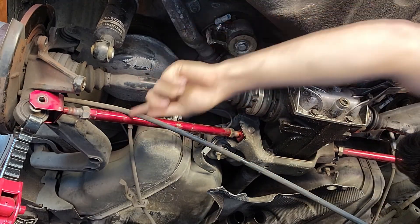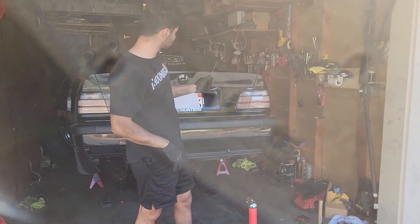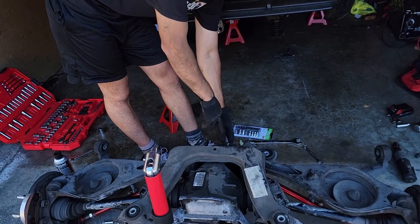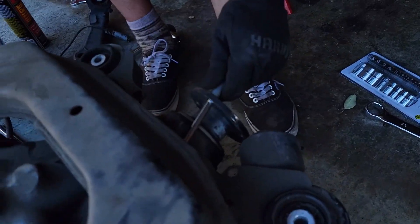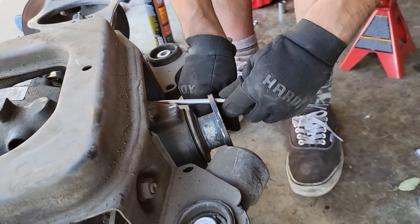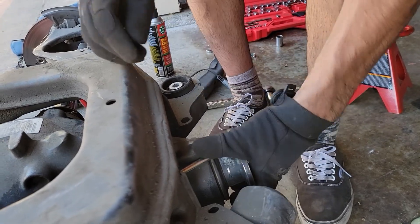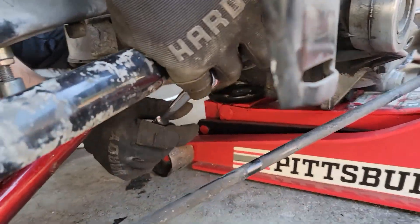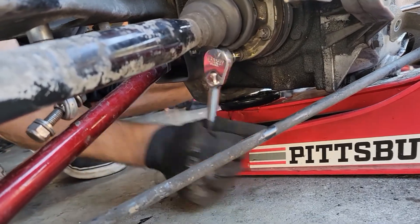This is in my old video for the diff but I forgot — my homie RBL reminded me about wedging your screwdriver. So you wedge it in here. On the left side you lock it here, and for the right side you use this to lock it so it doesn't spin and you can take it off. I'm just gonna show you one: lock it in here so it won't spin, put the ratchet in here, make sure it's all the way seated because these bolts are bad unless you convert to the Allen ones.